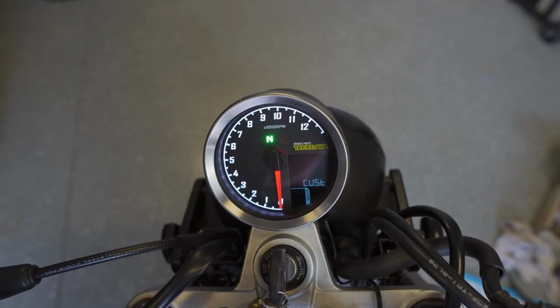This is the gear selection that I was speaking about earlier. This is the warning light. I'll go through this. So for speed, actually for some reason it's set at 89 miles an hour, because I'm not really looking to be warned about any particular speed. RPM, I guess I currently have it at 9100. Here, I'll change that to 9200 for demonstration purposes. And then engine temp. Currently it's set to 212 degrees Fahrenheit, which is fine because it's not connected to the engine. So I think once I actually have the engine temp sensor on, I'll set it to about 220 degrees Fahrenheit.